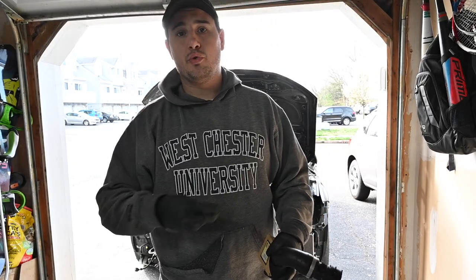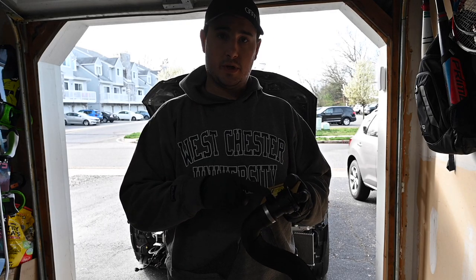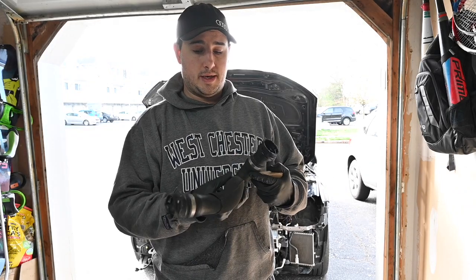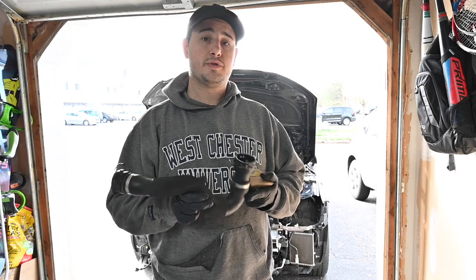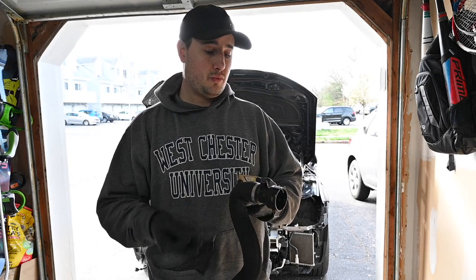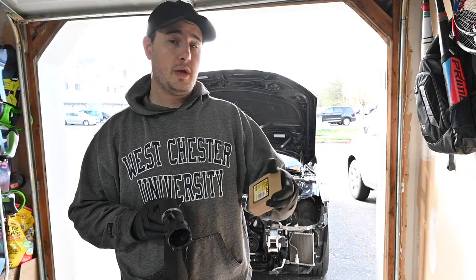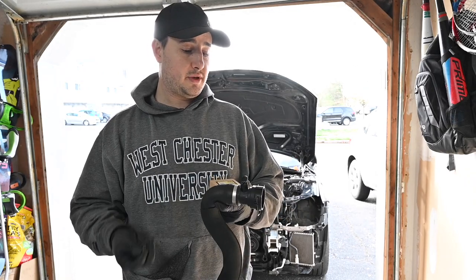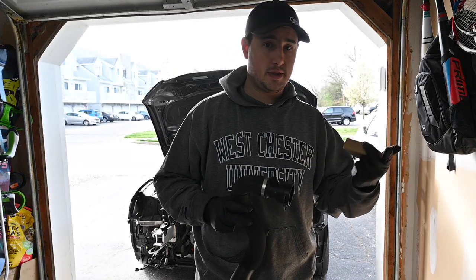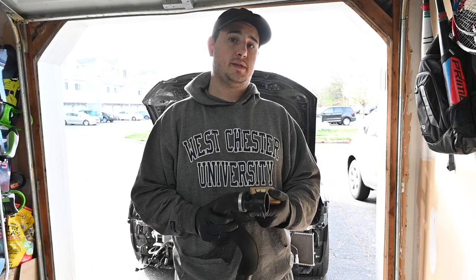I actually had to take the assembly off because I noticed the bleeder screw on the lower radiator hose was missing. This screw just allows all the fluid to come out for a quick coolant change. The dealership told me I needed the entire radiator hose for $130. After some research on forums, I found the thread pitch and found a Dorman part number 902-404 at Advanced Auto Parts — it was an exact fit and went right in. Use your resources, guys — don't listen to dealerships telling you to spend a lot on these tiny things. Audis are expensive, but they don't have to be as expensive as the dealerships make them out to be.